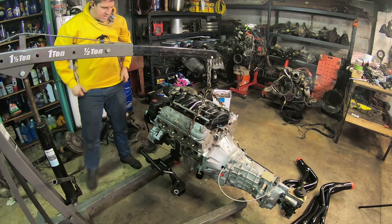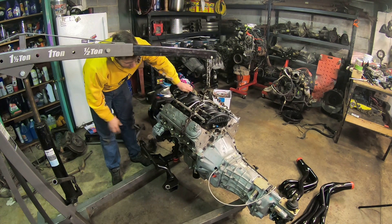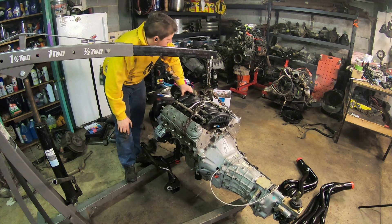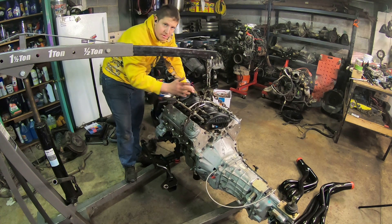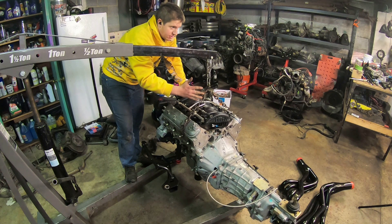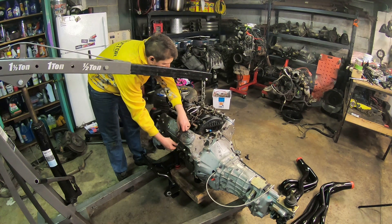Okay, that's got those finger tight. Now I want to get my headers bolted on and also want to get this thing sitting on dollies. I'll need my big dolly and a smaller dolly — one under the K-member and one after the tail of the transmission — so hopefully I should be able to pretty easily roll this under the car. It turned out I only needed one dolly, which is excellent. That makes it a little bit easier to move around and gives me a little bit more space.